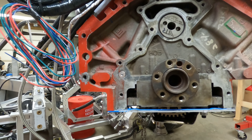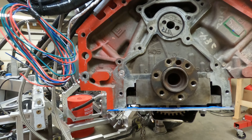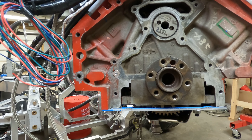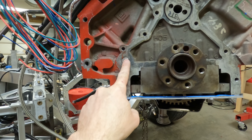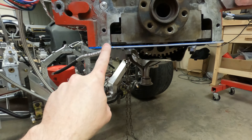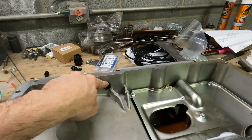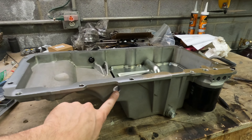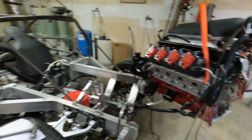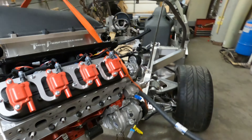It was recommended to replace this — I did not know this originally, as I've never rebuilt an LS engine like this before. Once I found out I needed to replace that, I decided to take the engine back apart to this point and bought an aluminum one as a replacement. The oil pan had to come off also. This is the oil return from one of the turbos, but one fitting wasn't enough for both turbos, so I drilled and tapped a hole here for another fitting. I'm waiting on that fitting to come in, as well as new gaskets and rear main seal before I can put this engine back together.